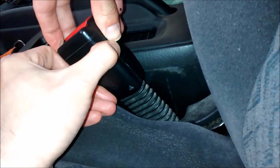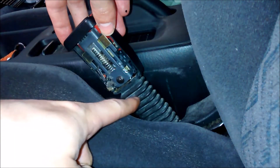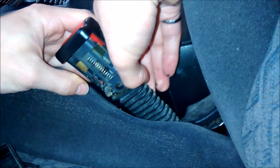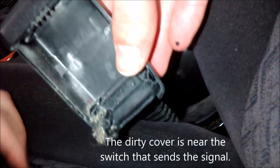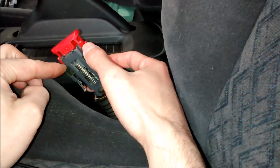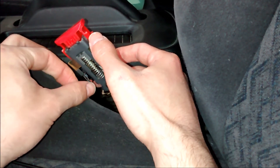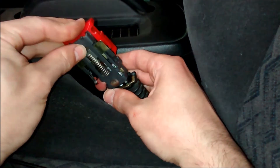Once that's off, this cover swings out from the bottom and then down. One thing to note is this rubberized handle — the last piece is clipped in at the bottom. Make sure when we put it back, we have it clipped properly. This back end swings outward and then up. Inside the seatbelt, when you latch it, it pushes down on this metal area, compressing a spring. This arm forces a small metal piece inward, pressing against that red seal, with a little nub that sticks into the black area in the back — that's how the seatbelt buckle switch knows it's latched.